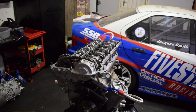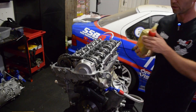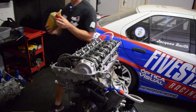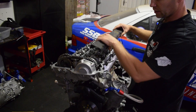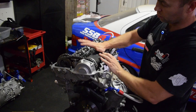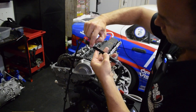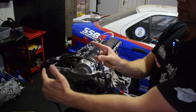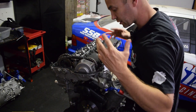Going to run through all the cam caps — quite thick oil here to protect from startup. We'll put a couple of bits over the cam — doing exhaust at the same time. Oil over the camshaft. Install the intake cam splash cover — that's to stop oil running out of the breather in high-load situations. In the corners on the valve cover gasket, this is where it's most susceptible to leaks. Everything torqued, it's tight, it's ready.